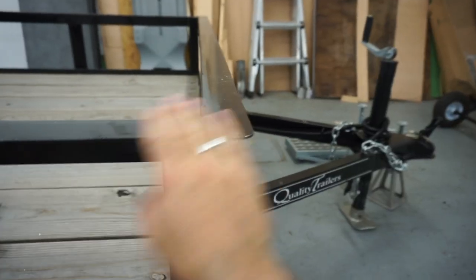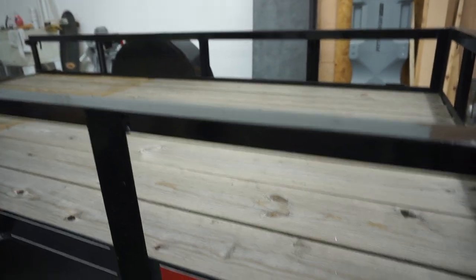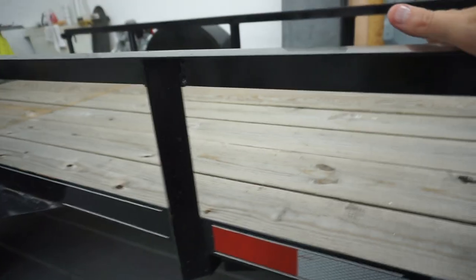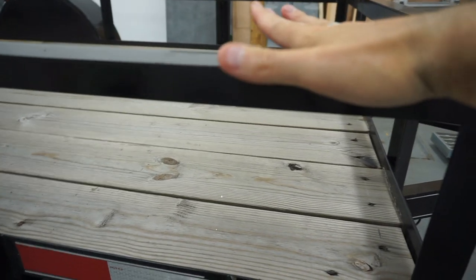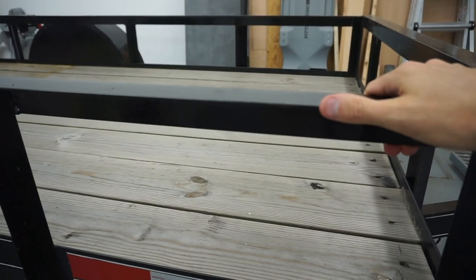The trailer has the wood decking and it also has this raised edge — angle iron, so steel — and it is incredibly strong. I'd never suggest that you remove this in any way, because it's actually part of the structure of the trailer itself. It's basically the same angle iron all around, just configured into different shapes. I love this because it gives you a beautiful flat surface that you can mount stuff to from the top or from the side. Some trailers have a tube top, and that's completely impossible to attach anything to. So avoid that — look for the angle iron.